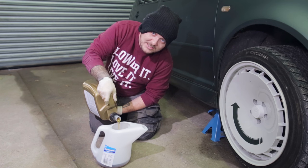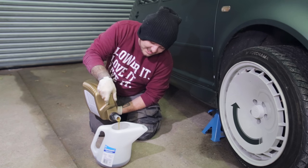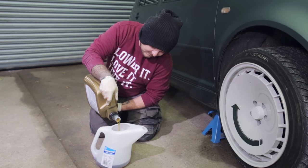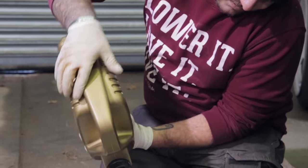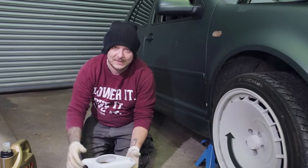You can actually do more damage to the engine just by overfilling it. The top tip would be to find out the capacity of the engine and fill up a jug just to that level. On the Golf it's around 4.5 litres, so that'd do nicely.